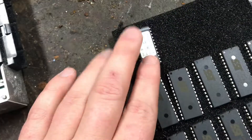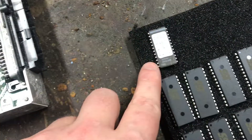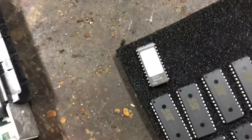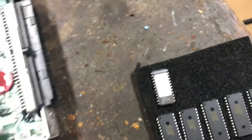In order to get these chips, they're old stock. They require a higher voltage to burn, so they can't be done with a USB chip burner. And on top of that, they're not re-erasable. If there's a mistake made, if there's a correction that needs to be made, a replacement needs to be sent out — it requires a new chip every time.